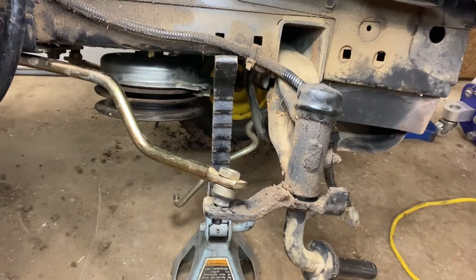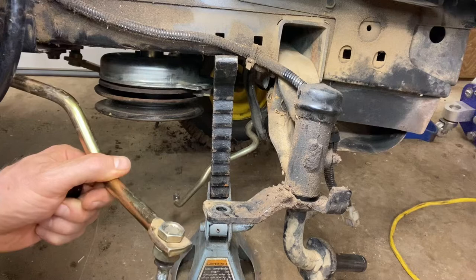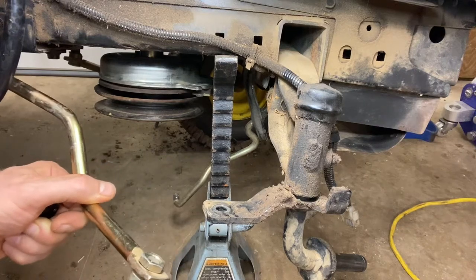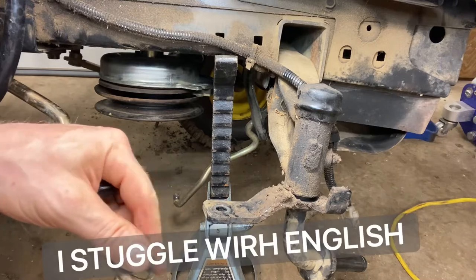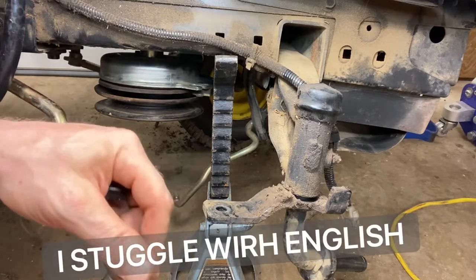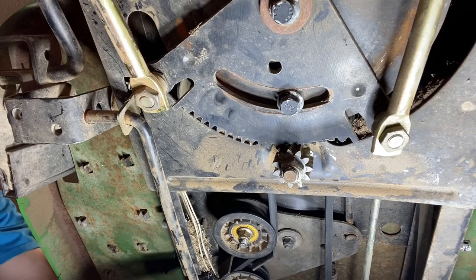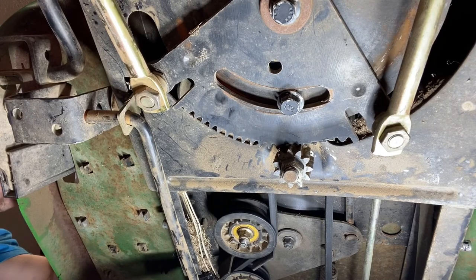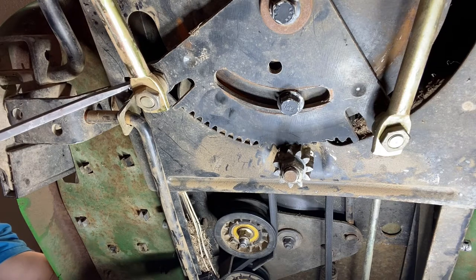When you pull it up, you get the whole ball joint assembly and the drag brace. If you're just doing the drag brace without the ball joint assembly, you would put that 15mm on there and then just undo this bolt on top, which is another 17mm, and you can pry that off. Now we've moved underneath the lawn mower. We've got the front of the drag brace unhooked. Next we need to figure out how to unhook the back of the drag brace.